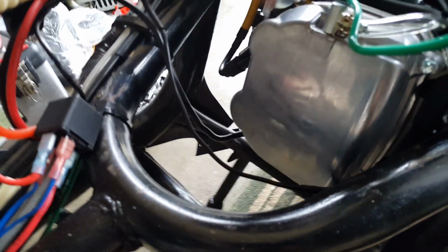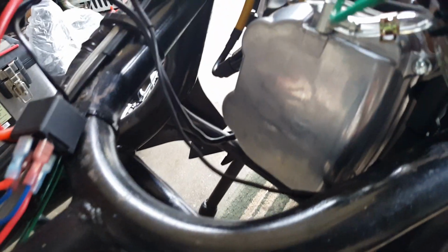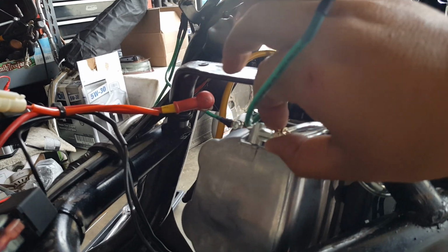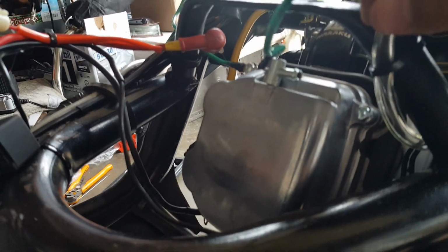All right, so how we're gonna keep this down, here we go. See, if I'm pushing on the bike frame, this lowers enough here where we can teeter-totter our way. So I think this might work just fine. You can see it's yanking on this hose. So we're gonna start dismantling the hose line for the crank ventilation. Pull that, or I'm gonna try to anyway. This sharp thing is getting in my way a little bit. All right, let's see. There we go. Give it a good more tug. There we go. The crank ventilation line is off.